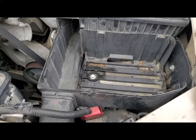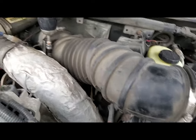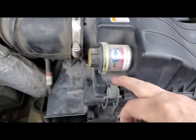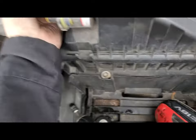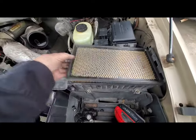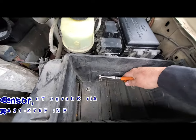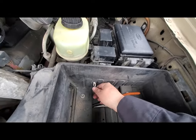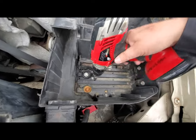Now that it's loose, lift the battery out. You're also going to have to get this air box off in order to remove things easily. Hit your 8 millimeter and back this off, release the clamps on the back, and pull up on this — this is where your air filter is. Set it aside, pull your air filter, then grab your MAF sensor with long needle nose, twist it counterclockwise on the main body, and wiggle it out. Don't forget to put it back in — you need it for your engine to run properly.